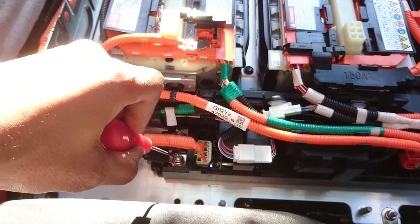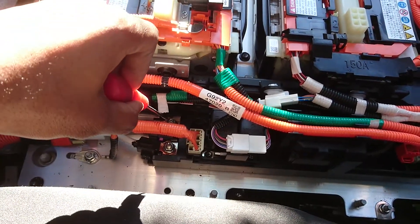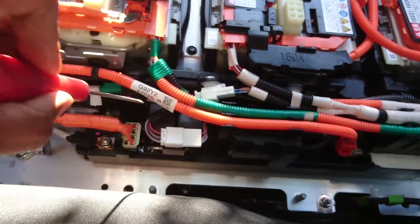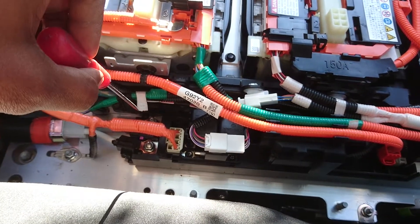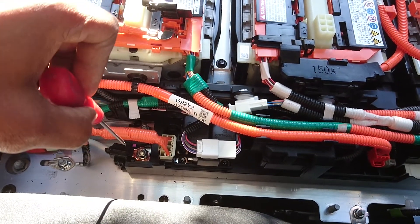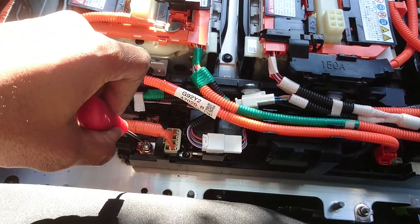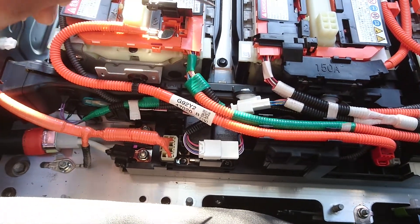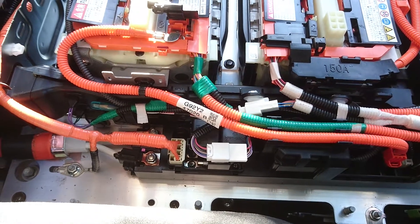If you're going to connect here — this side is positive, this side is negative — on the other side of the relays and contactors, always make sure your battery pack is switched off first before you turn off the car. When you turn off the car the relays and contactors switch off, and they don't want to see power here. If they see power here, boom — everything gets fried, everything gets damaged.